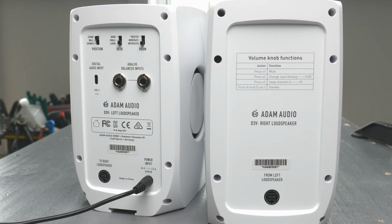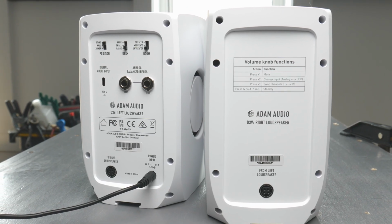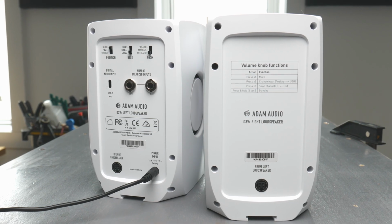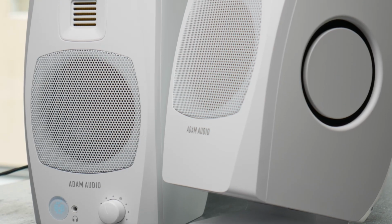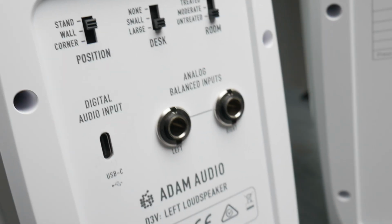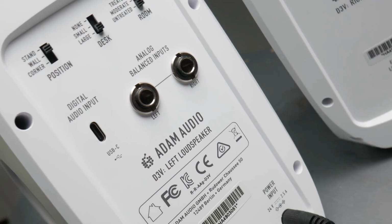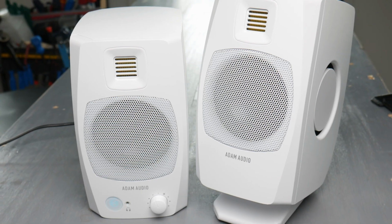For purpose-built studio monitors, it's generally more common to see 2 identical active speakers, as you really want the internal volume of the speaker enclosures as well as the audio signal paths to be as similar as possible from left to right. For the intended application here though, I don't mind how they've done it, and with the ability to swap which speaker is left or right on these, you definitely don't have to have the volume control and the headphone output on the left side of your desk if you don't like the default setting.